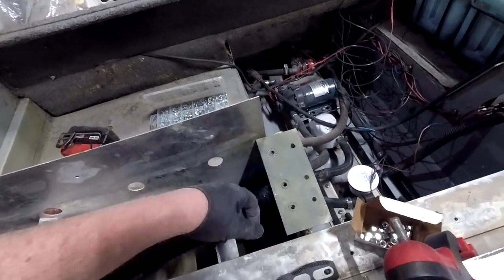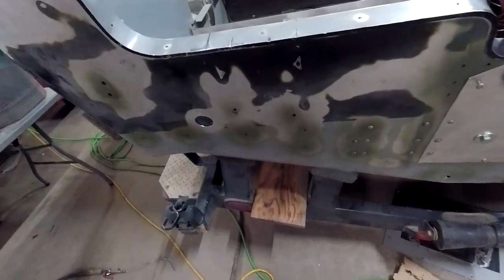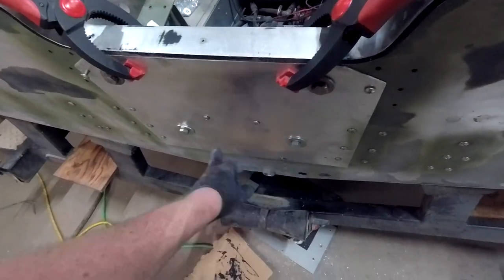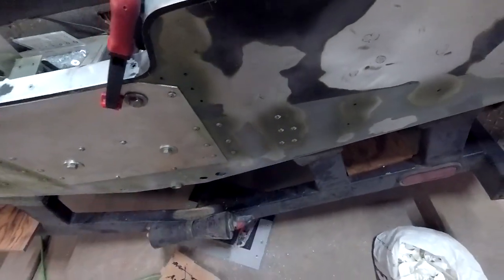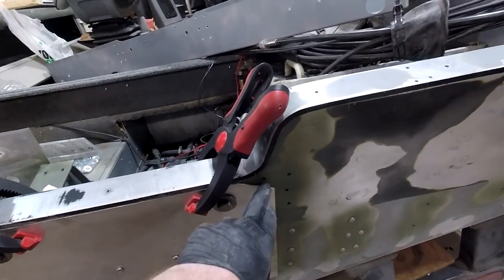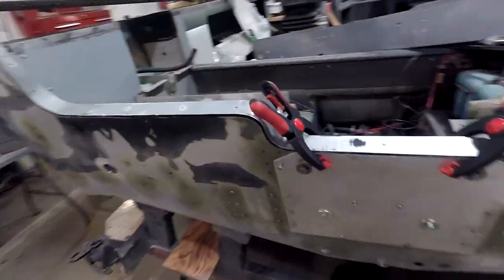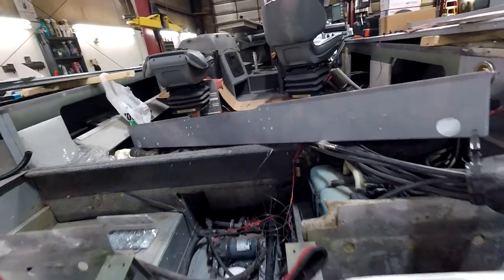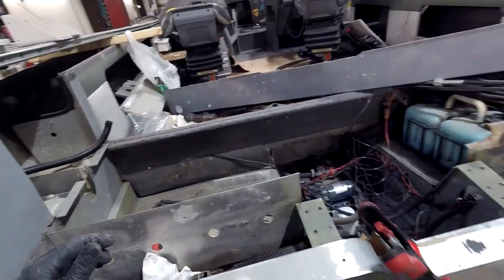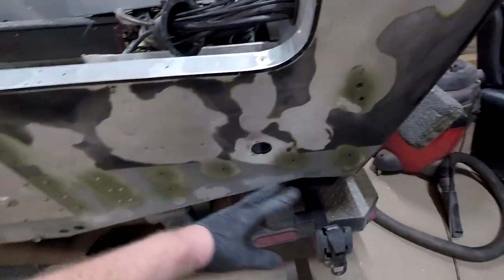I've been spraying self-etching primer. I'm assembling right now and putting sealant on the screws going in permanently. The motor plate has a nice cut-out and the inner skin is looking great. I worked on the splash well and got that all ready. My friend Todd came over and we welded up a couple of cracks. It's day three, almost two in the morning — I've got about 10 more screws to put in and that'll be it for tonight.